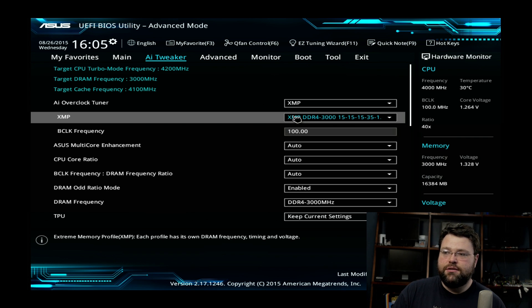The motherboards we're testing report overclockability up to 3400, 3600, 3866 — really high speeds, just about 4 gigahertz in terms of system memory. The reality is that unless you're using onboard graphics, it doesn't really make a lot of difference in performance. You've got a little more bandwidth and headroom with DDR4 than DDR3, but the speed of the RAM really doesn't make a huge difference. It does help a little with compression or moving very large files, but RAM is still not really a bottleneck even then.